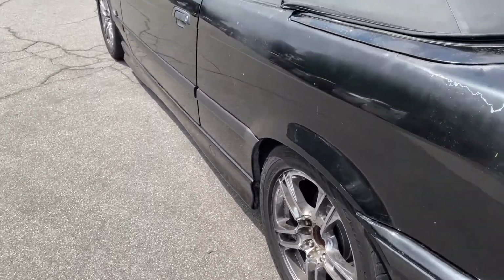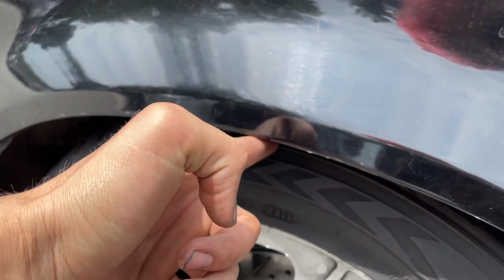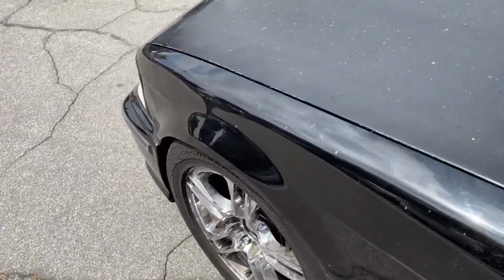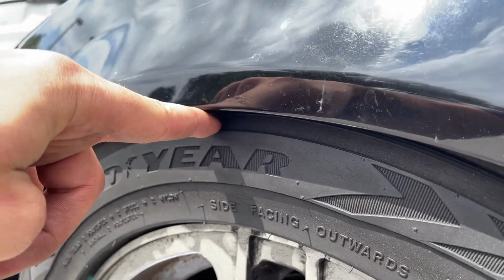As you guys can see, remember that I think the rear was 4 or so before. Now I can barely even really get 1 finger in there. And then, boom. Not even a finger in there. Last clip got a little distorted and all, but it feels really great. I cranked them up to about 19 cranks from soft all the way up to hard. And I mean, they feel awesome.